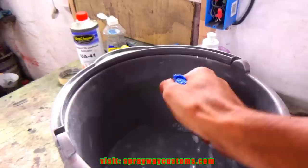Just finished up with the 2000 all the way around. I know I said I was going to do a two-step. I was going to go with the 2000, then go back with 3000, get the 2000 scratches out. But I'm going to skip the 3000. I'm going to be using my rotary, and I can get these 2000 scratches out pretty easy with the rotary. So we're going to get rid of all our cutting material. But first, I'm gonna wipe it down, make sure ain't no trash or anything that landed back on the surface before I start buffing.